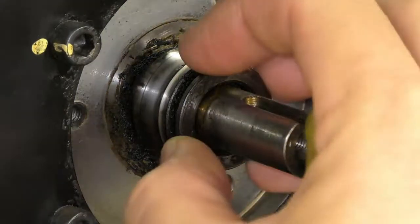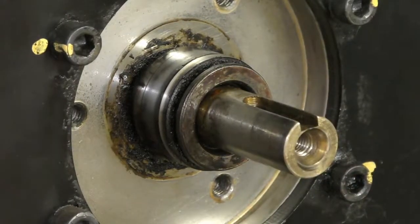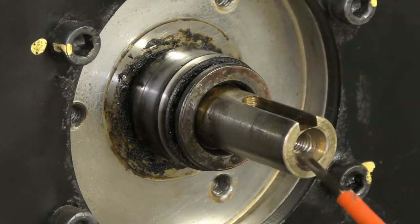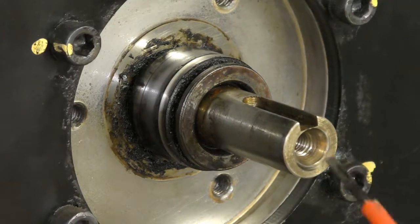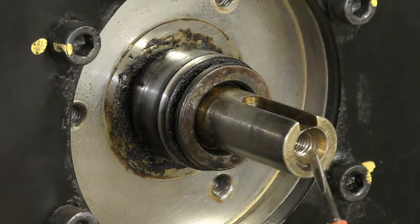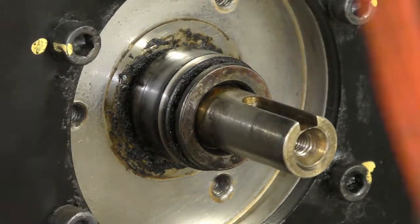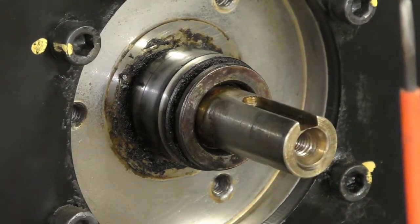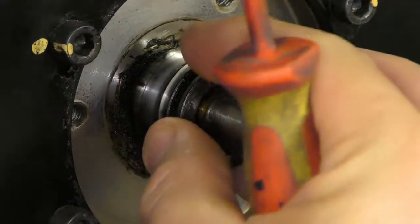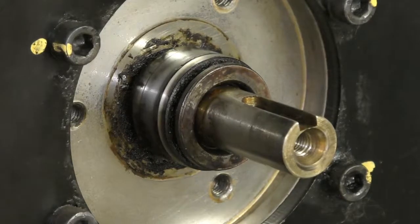The data will be here. I'll pick up that taper that's in there. Normally what I do is put a ball out of a ball bearing in there so you don't damage that taper — because I'm a machinist and I hate it when people wreck those. Normally you'd sharpen a tool and fix all that, so if you put a nice hardened ball in there the right size and cut the end of your puller, the ball's that hard and smooth, generally it'll slide either on the puller or slide in there and won't really wreck anything too much.